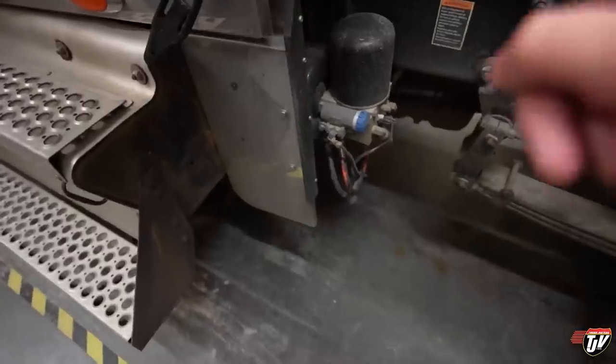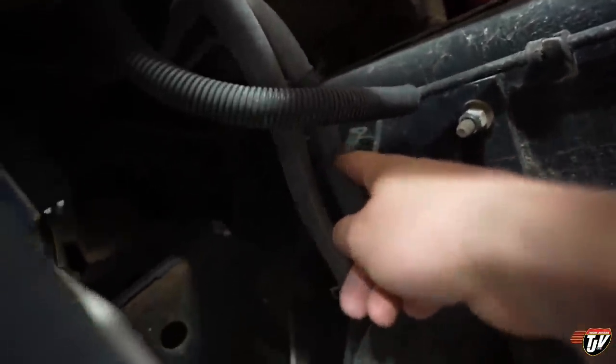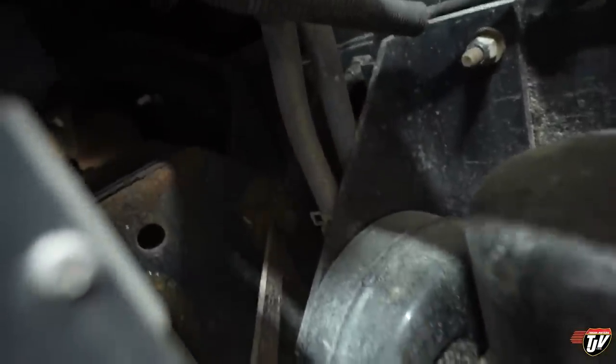So I got back to the shop here. I crawled underneath it and I found out. No wonder. Steady drip coming from the heater core under the sleeper. So I went up in my engine bay. I'll show you. Behind my air dryer here, right behind there, you'll just have to trust me. There's the coolant line that comes up here and then goes behind all of this and it comes up right here, okay? And there's a valve on it there. That's the heater, that goes to the heater core in the back. I just closed the valve and the leaking stopped immediately. So it's a temporary fix, but it'll do the trick for now.